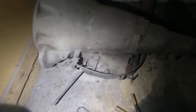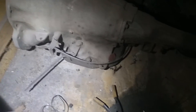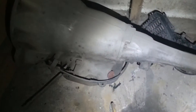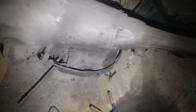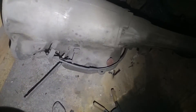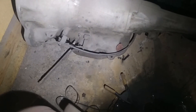I'll give a quick update. I've been thinking about this transmission situation I'm stuck on, because this is a 65 trans - it's sort of unique. It's got two cables: one at the front which works the shifter, and the other one that goes in the back. The back, at the start of the tail housing, is the park brake, which is unique to the '60-'64 models, and possibly some of the early ones too.